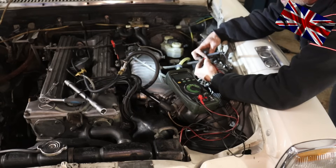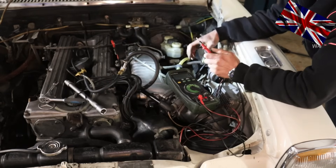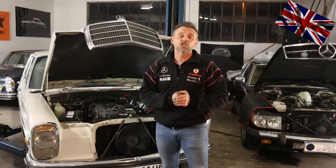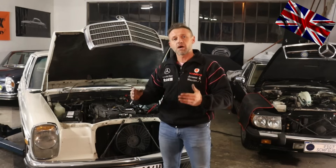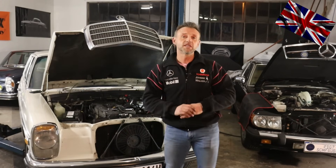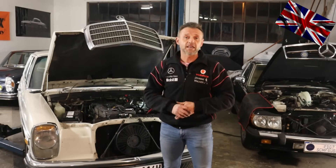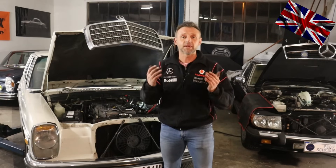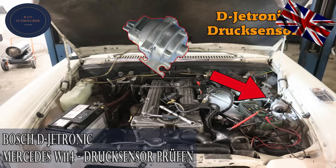Before reconnecting the terminal to the socket, we switch off the engine — nota bene. This is it: the D-Jetronic, a relic from the past. It works very simply in comparison to K-Jetronic — you always get the same fuel pressure at the injectors; only the timing of injection changes, measured in milliseconds. We'll continue with more chapters on this simple and reliable injection system. Thank you all for watching, see you next time — bye-bye!